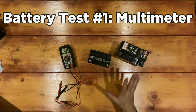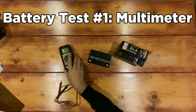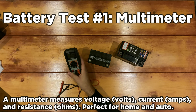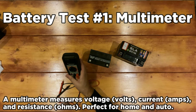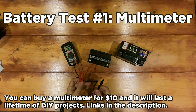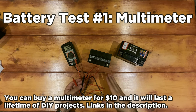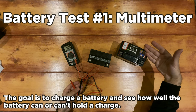There are two ways to test a dead motorcycle battery. The first way is with a multimeter. A multimeter is a great tool because it measures voltage, current, resistance — you name it. You can use it for testing your motorcycle, your car, your house electronics. To use it, set it to 20 volts, positive to positive, negative to negative. But we don't want to test batteries when they just came in from being ridden, just charged, or sitting outside for three weeks.